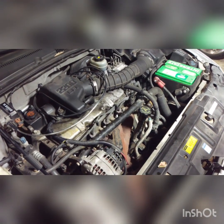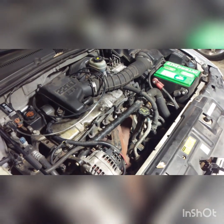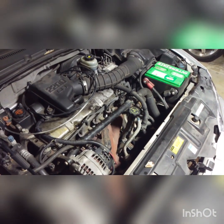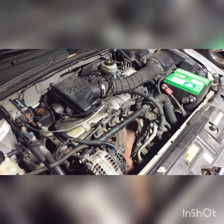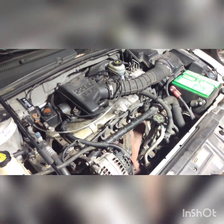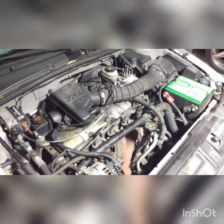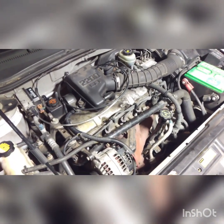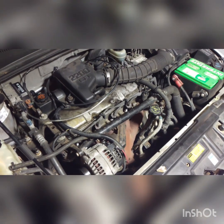We got coolant in it and oil, and we started it up. We were trying to get coolant in it, but then it started to look like it was running a little hot. So we turned it off, and what happened was we didn't have all the coolant in it that was necessary. It takes about 3 gallons of coolant for the whole thing. It's a sealed vacuum system.